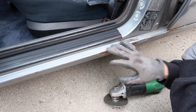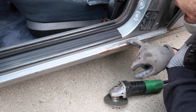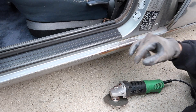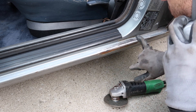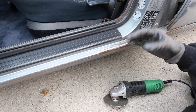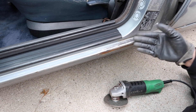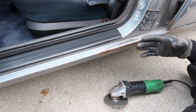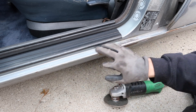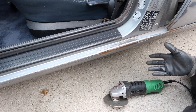After sanding with the 50 or 60 grit, you can see it does get the rust out, but you can see where it's pitted. It's surface rust — you can get it out but it's still pitted in there. That's what I mean when I say it usually comes back, because rust is a chemical thing and once it starts it just keeps going. We can spray over it, but this isn't going to prevent it — the car is still going to be rusting actively. I just want to make it look better for the time being.